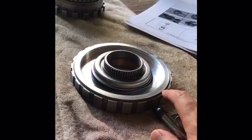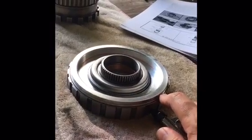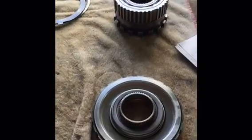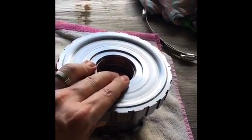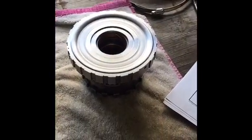When the system gets fluid pressure from the hydraulic pump commanded by the valve body, it'll compress and push the clutch pack together to engage a gear — that's reverse and low first gear. The system is all set up and ready to go. We'll package everything in an airtight bag. The low roller clutch will let it rotate one way but not the other — you can see it counter-rotate, it only goes one way. That's the low roller clutch system. There it is — the new setup.